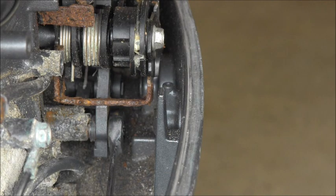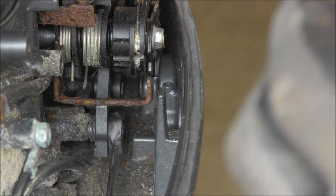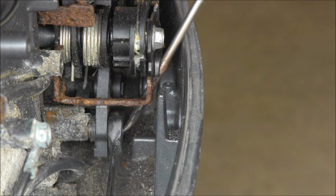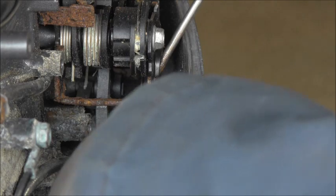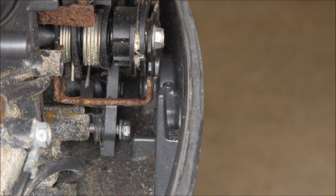So there's the gear wrench on it now. Well, now it's going to want to just flop too. So what I do is take something like a screwdriver or a pick, get in here and put pressure on that bolt. Then it can't just flop around on you, and then you screw it out with the gear wrench by keeping inward pressure on it. Sounds simple, but if you don't do a lot of these, now the bolt's out. If you don't do a lot of those, and you're like, well, that thing's just spinning back and forth, that's a little hack you can use.